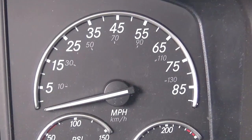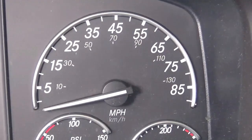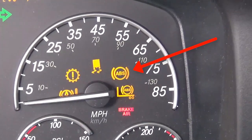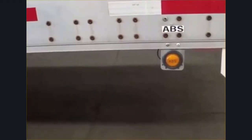For the ABS light, what they'll be checking for is to make sure that it comes on for a few seconds and then goes off. For the trailer ABS, they're looking for the same thing — basically key it on, make sure that it comes on for a few seconds and it should turn off, indicating that there are no faults in the system.